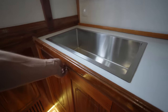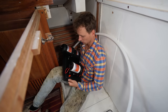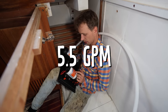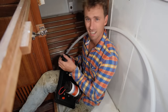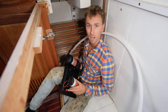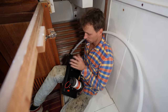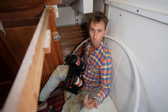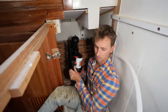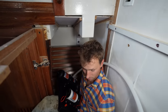I'm here under where the sink in the galley comes. I'm also going to install one of these — a 24 volt, 5.5 gallon per minute fresh water pump and a tiny one liter accumulator. We're going to start with this for now and see where we need to expand, whether that be the size of the accumulator, one pump, two pump, three pumps. This is what we're going for now and it's going to go right against that wall.